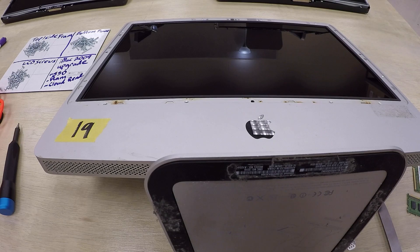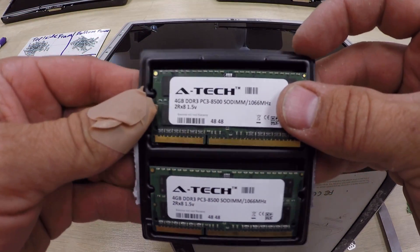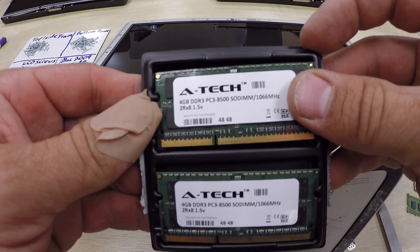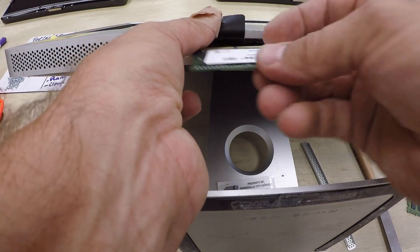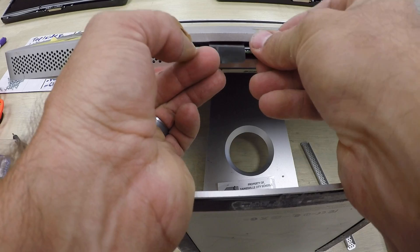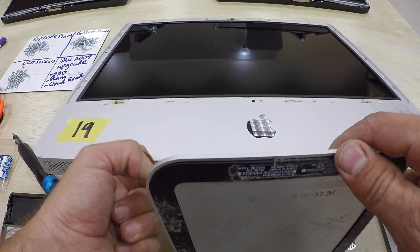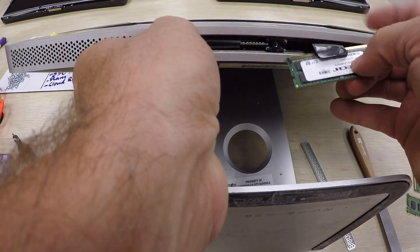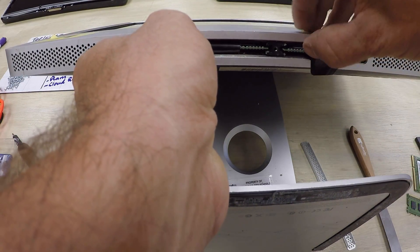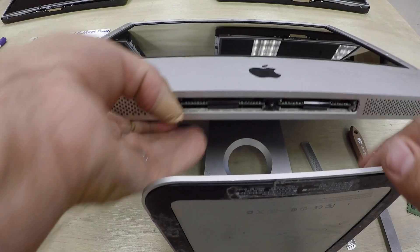Take your upgraded RAM — I'll have a link in the video — and install two 4GB RAM modules. Put the small side on the left and the large side on the right, slide it into the tray, and push with your thumb until it clicks. Then tuck the ribbon back in underneath the RAM. Note: if your computer beeps randomly after reassembly, the RAM is most likely not fully seated in the slot.